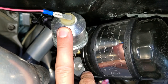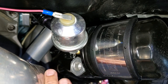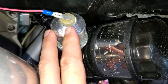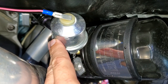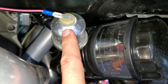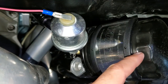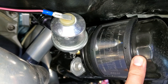Here's my oil pressure sending unit — it's right next to my oil filter. My oil filter is on the frame of my car, and this is the header collector area. I suspect we're getting some heat soak and it's affecting the gauge. I'm going to take this cable off and see what the gauge does, just to make sure we have full sweep. If we do, we're going to change this out for another one. For those interested in why I have a remote oil filter, go check out that video — it'll show you the details of how I did it.